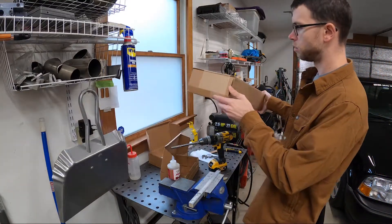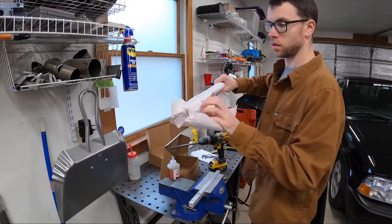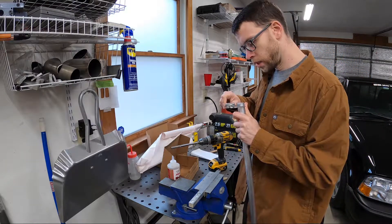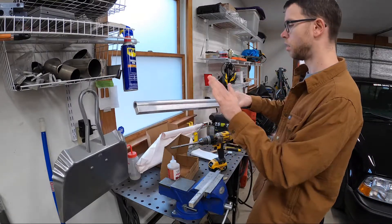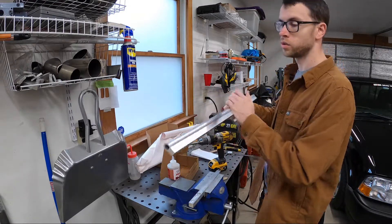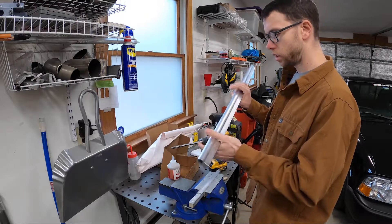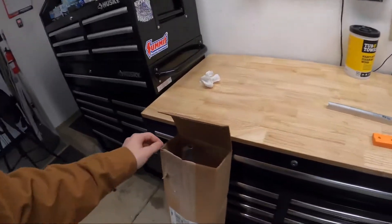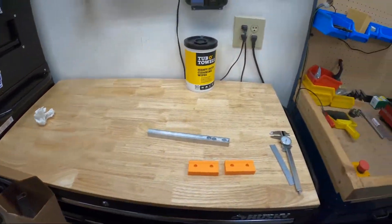Also got this in the mail — I believe this is the fuel rail stock, a three-foot section. A little bit bigger than what I found online but I think it should work, and this should be excess in case we have other projects. I just need to figure out the intake manifold before I can determine the length and measure injector spacing. I modified the drawing to match those dimensions versus what I found online and I have the machining pretty much figured out.